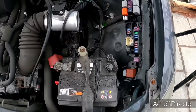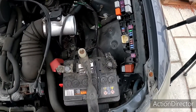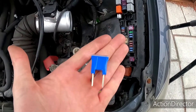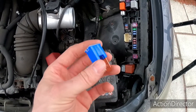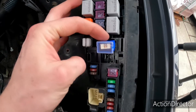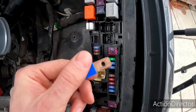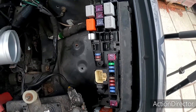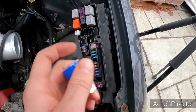It's been four days since my last video - I was waiting on the fuse. It doesn't make much difference in the video because it just runs into the next clip. This is basically what your 100 amp fuse looks like - it's dead basic. That fuse is what I'm going to install. Obviously that slots into that slot, and from above it looks like it should just be able to pull out, but obviously you've got those tabs on there which are bolted into the car. I'm going to bolt them back up and crack on. I'll show you how to put it all back together again.